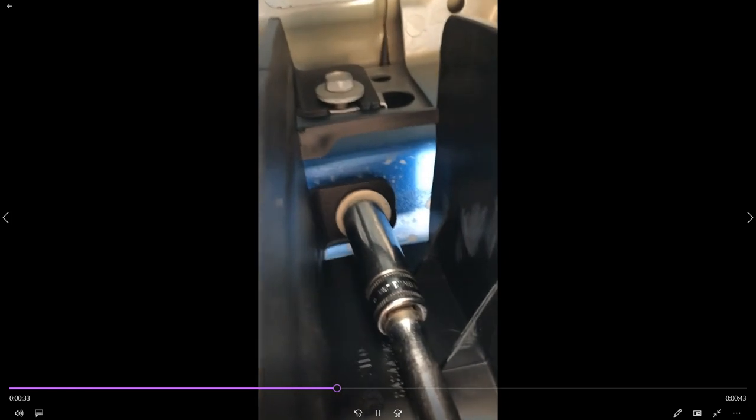And this is what it's going to look like to go ahead and tighten these ones. Now, I'm just going to go ahead here, and you got a washer on here, so it'll actually hold itself in the socket. But make sure as you're threading these, you start these by hand. And I wouldn't snug anything up until I have every bolt in. Once you know you've got every bolt in, it'll be centered where you need it to be. If you need to tweak it just a hair or not, it's just a matter of moving it before you tighten it. Going to repeat the process for the other 3 locations.